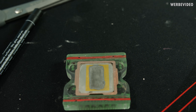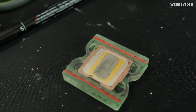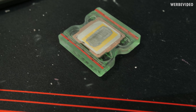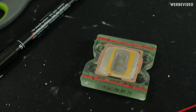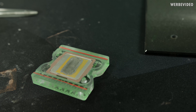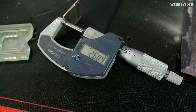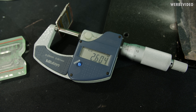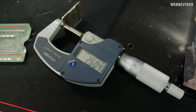15 to 20 minutes later I'm still one complete line away from the end result — it absolutely takes time. The reason is not only the copper I have to grind away but also the entire surface of acrylic which is constantly in contact with the wet sanding paper, making it even harder. About 15 more minutes and I finally reached my markers. Measuring the result: we have 2.604 millimeter. The starting point was about 3.06 millimeter, therefore we removed about 0.45 millimeter, which is quite close to what we were trying to achieve.